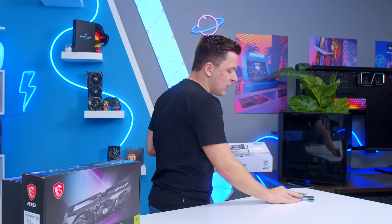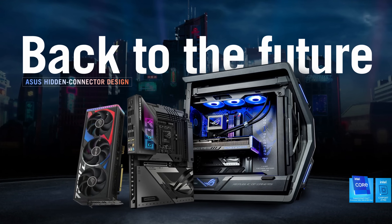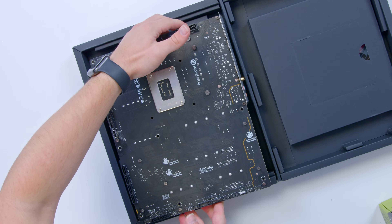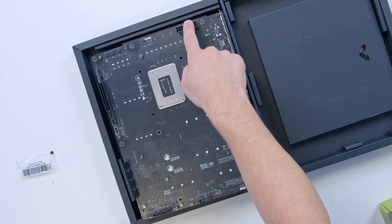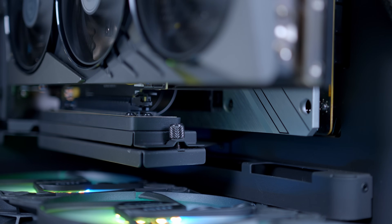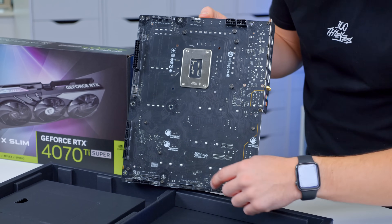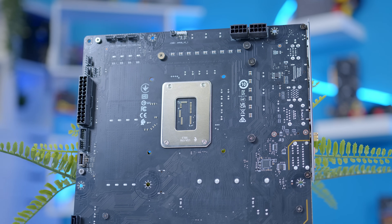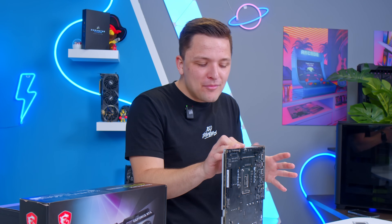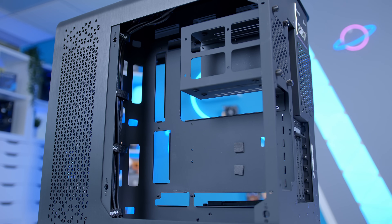As far as the motherboard goes, sticking with an MSI theme, I've chosen the Z790 Project Zero. Project Zero is basically MSI's version of Asus BTF — they came out at the same time, and Gigabyte piloted this a long time ago but haven't brought much out since. This design feels really quite high-end and fancy. Basically, it moves all the fan headers, RGB headers, and power connections to the rear of the motherboard, meaning on the front of the board you have no visible cables or connections. This makes cable management look a lot better — no power supply cables to worry about, as these are hidden at the rear. And from a building point of view, when you need to access that finicky USB header at the bottom of the board or reseat a CPU power cable, you're not going to be cramming your fingers through a gap that's too tight.